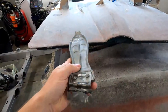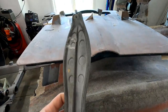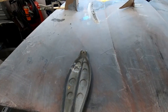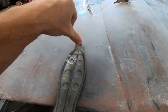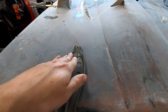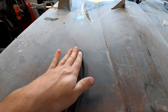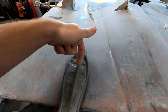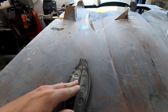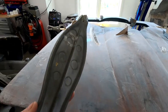I'm really happy with the way the gas pedal turned out. It's a pretty simple operation — just cut and re-weld the hinges. I didn't modify the pedal or the floor in any way, so both can be converted back to their original use. The only thing I have to do now is fill this inside cavity where the spoon part of the throttle will hit. I have to figure out exactly where that's going to be and fill it with some plastic or pour some urethane in here to give it something smooth to ride on, because otherwise it may get stuck or be jumpy. I'm going to make all this smooth in the back to make sure it's easier to drive and safe.